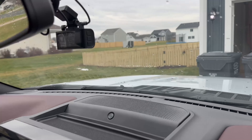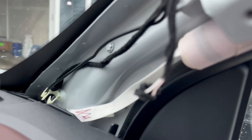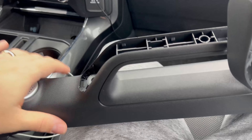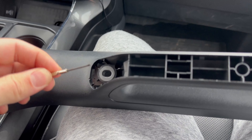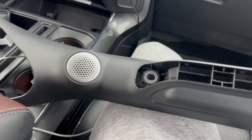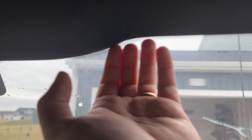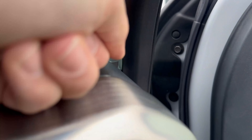For the more detailed hidden install, I removed the car's A-pillar or door trim piece — making sure to unplug the speaker. To take it off, insert the small pick tool into that little hole to pry open the handle, then use the 10mm socket to unscrew the two bolts. Pull the whole unit off, unplug the speaker, then run your cable through there. It already has a little cable holder built in — very useful.